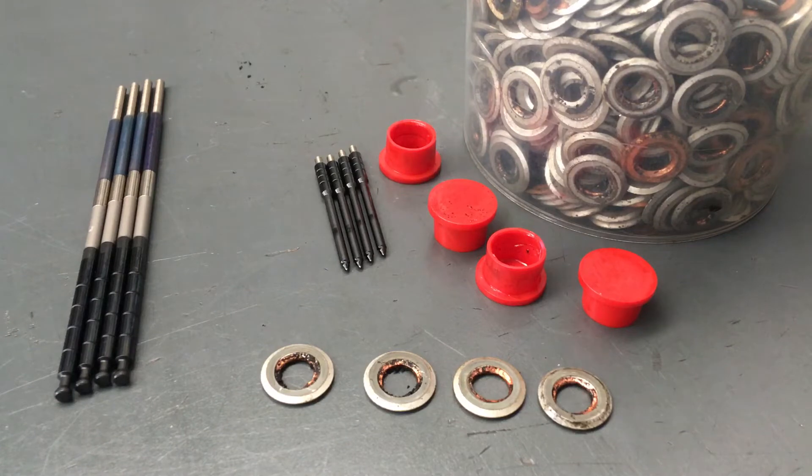These injectors were built in 2012 and they were in a 2012 vehicle, which is a little unusual — normally the injectors are a bit older than the vehicle. The consistency we're seeing is with people who have returned injectors that have done anywhere from 130 to 250,000 km's, complaining they're a bit noisy. These are full DLC coated injectors, which wear a lot better.